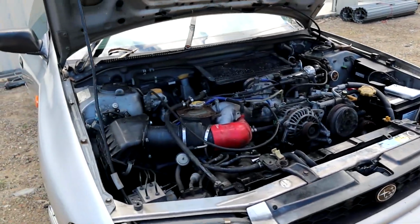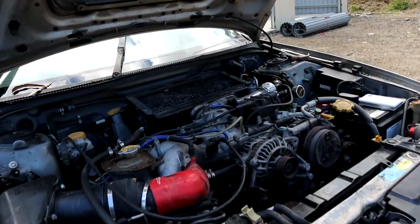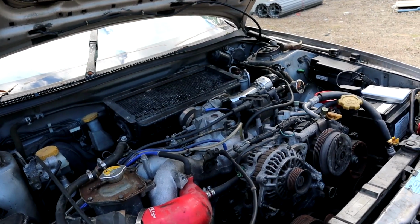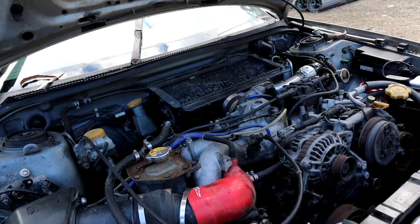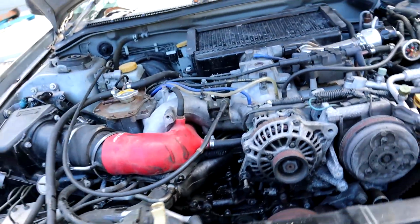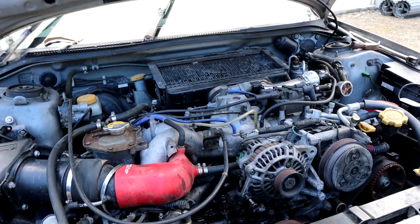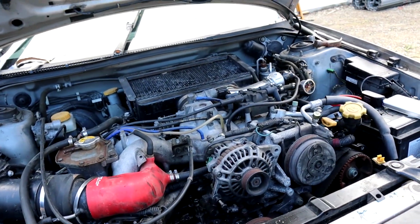So pretty much what we're going to do now is put some fresh oil in, try to crank it again, and hopefully feed a bit of that fresh oil into the bore, just around those rings, and get things to pick up a bit better. If that doesn't work, we're just going to keep working this balancer back and forth, and as the pistons move up and down, it'll hopefully scrape off all that stuff sitting in the bores, and it's just going to keep getting better and better.